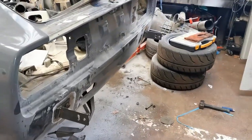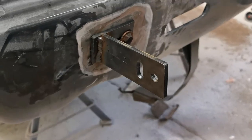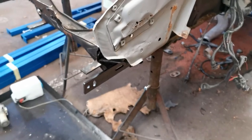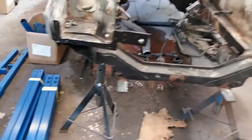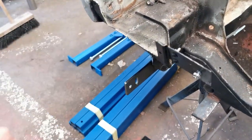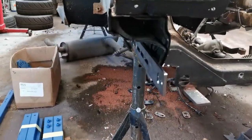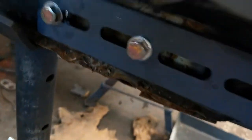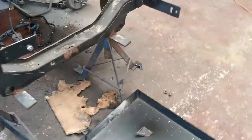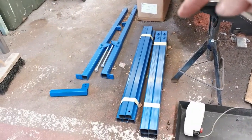The car is ready to take the jig — brackets have been welded on both sides. On the front we had the plates sort of underneath the car but they have to be vertical to take this piece. We had them horizontal so it was never going to work. No dramas though — we just had to space them out a little bit so there's just two nuts behind there and it has to clear a bit of the frame. Plenty strong enough, so we'll get the time-lapse out and start building.